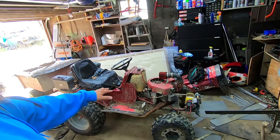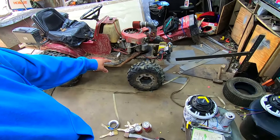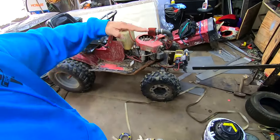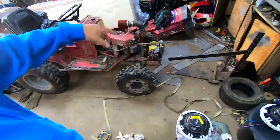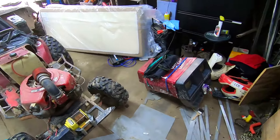So this thing will do a top speed of about 43 miles an hour before my fluid-filled tires — the front tires are fluid-filled to keep the front end down on hill climbs — start basketballing back and forth between the two tires and it gets super sketchy.